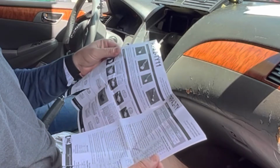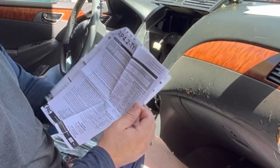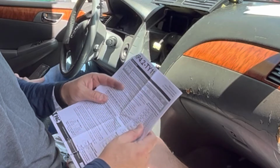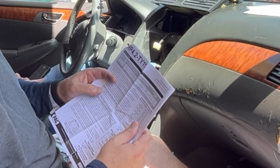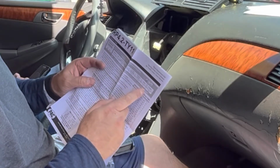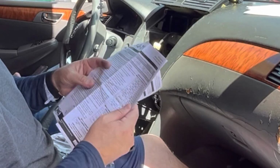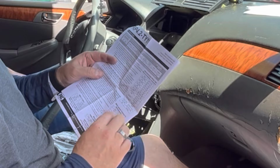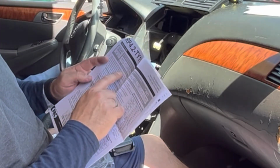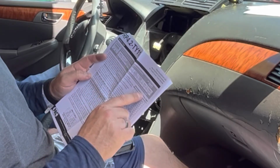There will be a link in the description, but essentially there is a broken-down system down here that tells you how you want to have your dip switches. There's one for Alpine, JVC, another one for Kenwood, Clarion, 2-wire resistive, Pioneer, or others, Sony, and Fusion. So most likely I'm going to be other. If we go down here on the asterisk, it says other is Dual, Xzent. These brands could also use 2-wire resistive, Jensen, Rockford Fosgate.